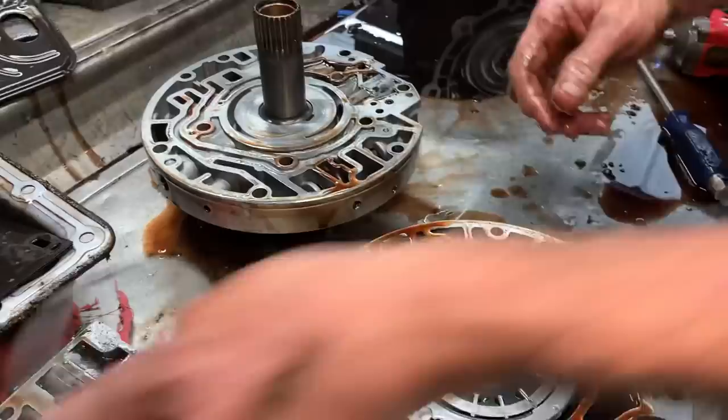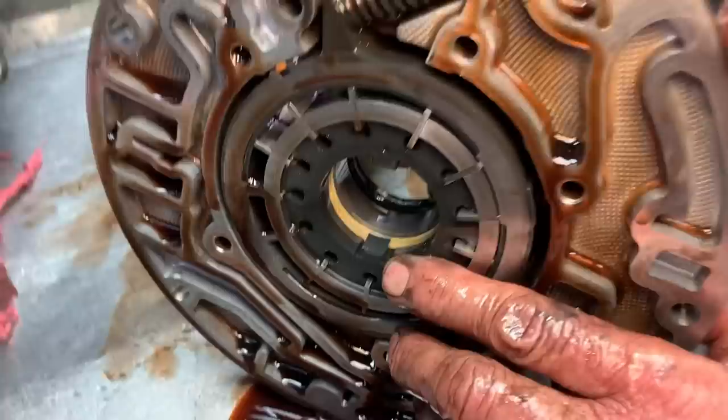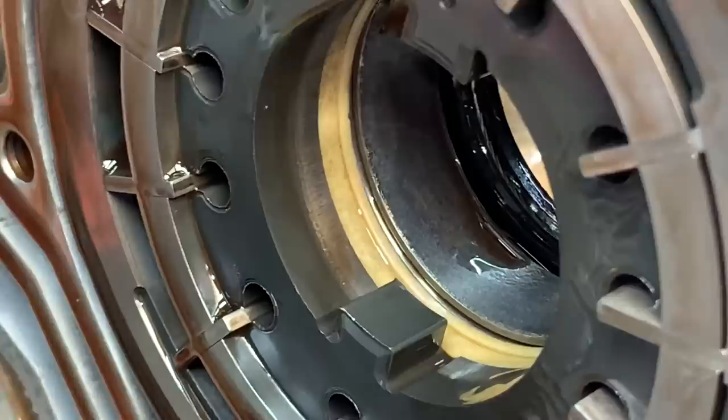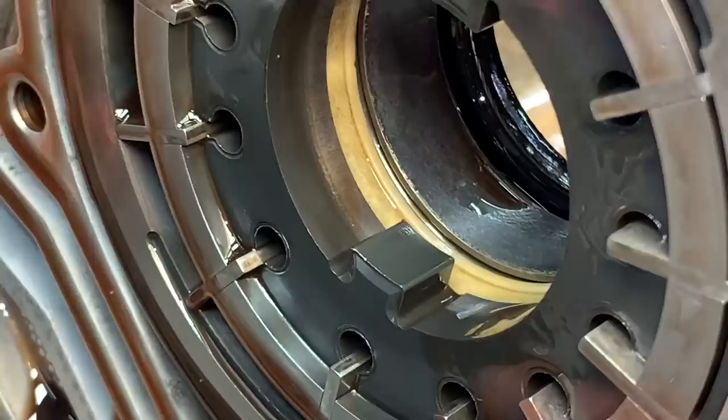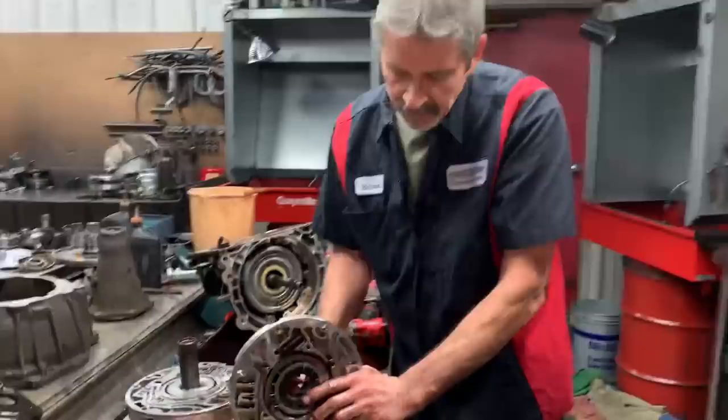Now if you look here, even on this tranny — you can see the converter has almost pulled plumb out of the gear. This is a stock torque converter, stock tranny, never been touched, this is from GM. Look how much that converter has pulled out — it's almost too far, more than halfway. So we would space that in because we want to grab more of that gear. Especially when you put a 500 boost valve in here — something that is going to torque up on this pump gear a lot harder — you definitely want to grab that whole gear. There are only two of them, and it will break them right off.